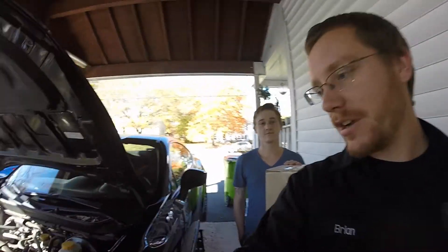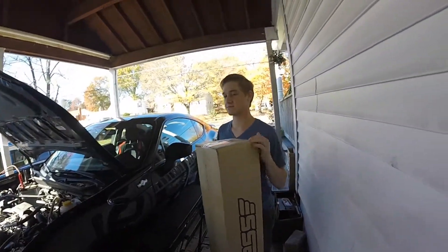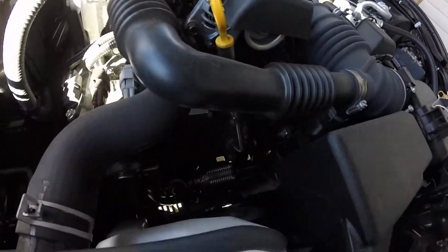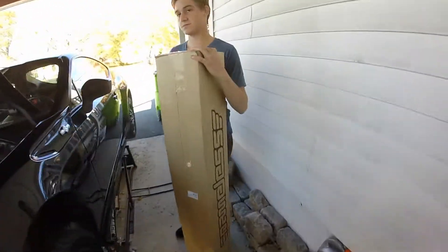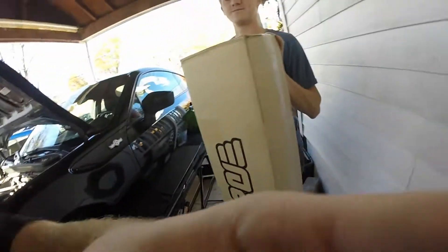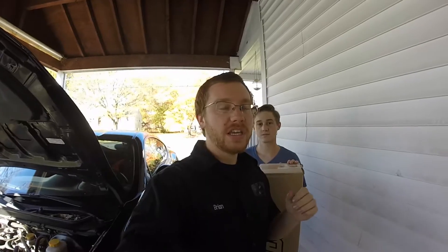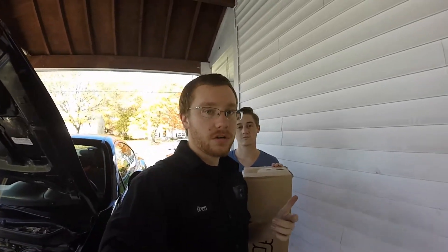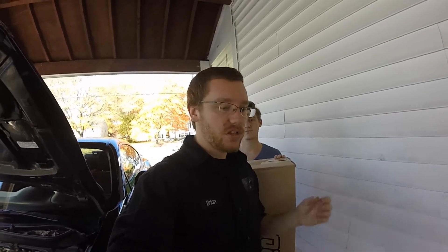What's going on guys? So today we are working on Ryan's FRS. He currently has unequal length Borla headers and a catted downpipe. Basically what is going on is he said that when he gets into the higher RPMs and hits it, it starts to turn really raspy. So we're doing a resonator reinstall because what he currently has is just a high-flow cap resonator delete, Corsa mufflers, and the Borla headers. He wants to switch to a resonator to help tone down the raspiness so he keeps more of a tone when he's hitting it.